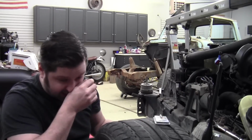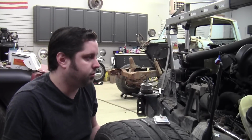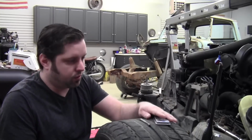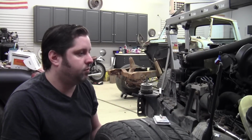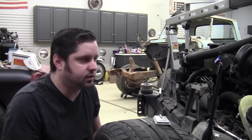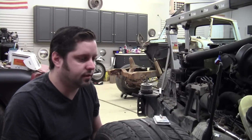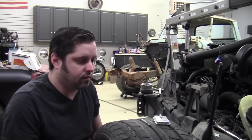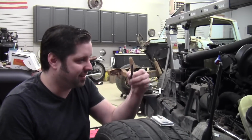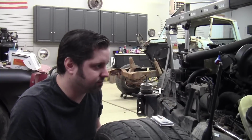And to me, it takes longer, but it's a guaranteed safe way to remove these studs without having to mess up, breaking an easy-out, pulling the whole head off, replacing all the gaskets, paying $200 to a machine shop, then however much in gaskets just to save a few minutes. Well, probably save a good hour, but still, going the safe, slow way is the way I like to do to get these out.